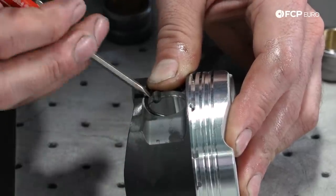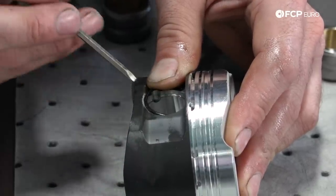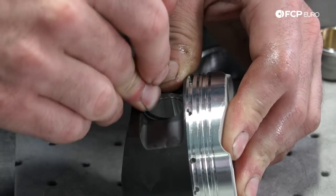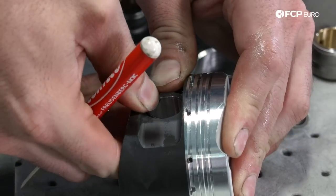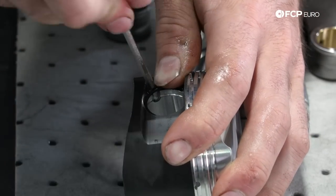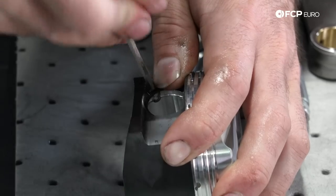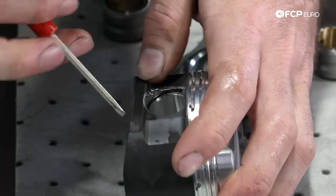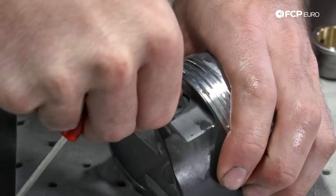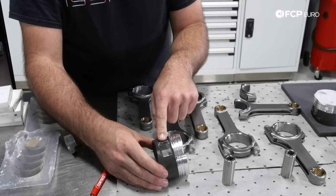The very first part of this process is taking our piston and the wrist pin clip, which I have partially installed here. We're going to take a screwdriver with a moderate amount of force and work that wrist pin clip around the edge. I like to use a small screwdriver or a flat blade pick — you basically have to work that clip in, and it's very tight to its little home.